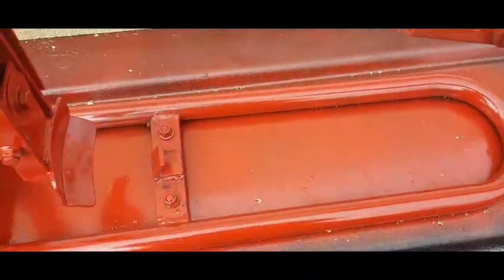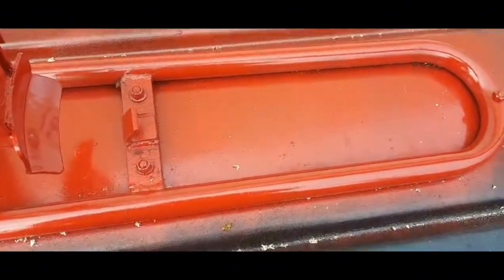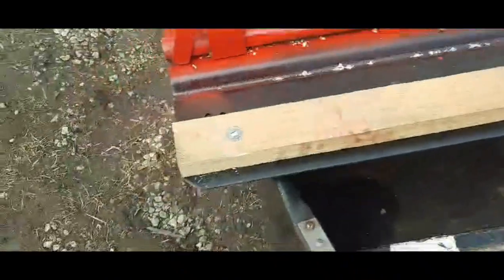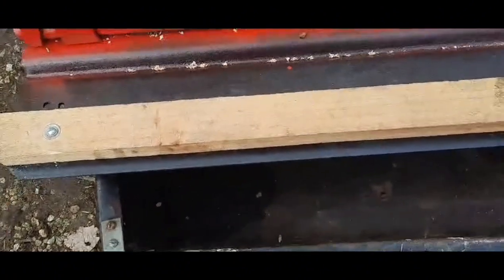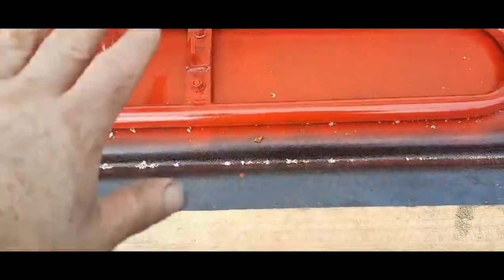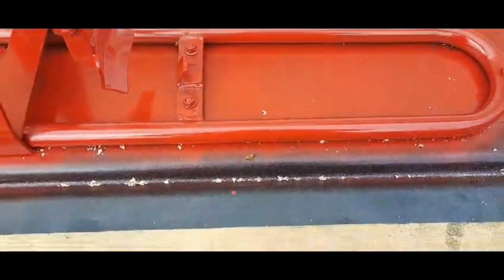I bolted it to this giant piece of iron here, put 3 bolts in it, and on the bottom of this, if you can see, those are 1 5/8 auto marine plugs that I bought at Menards, and I took the washers off of them and I just made feet for it. And the reason I put these pieces of wood on it was that way, if I put a rim or tire on here, as a truck tire, it's kind of wide and it's a little bit wobbly, so this will take up the wobble, so raise it up to about this height.